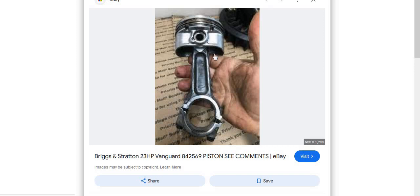They're all Model 38. This rod is terrible — notice that it's angled right here. I don't know if that's mostly for strength or just to clear inside the block when it's spinning around. This rod has to be replaced. It does not have rod bearings. The rod rides on the crankshaft. So that's got to go.